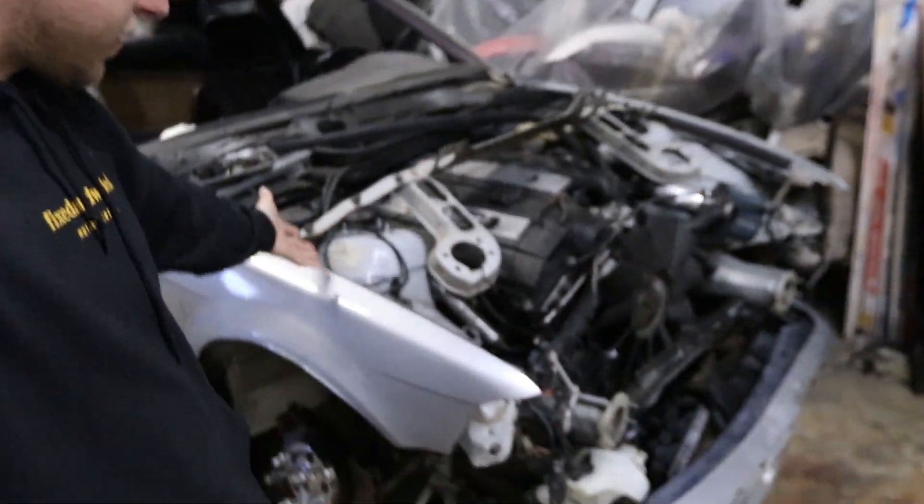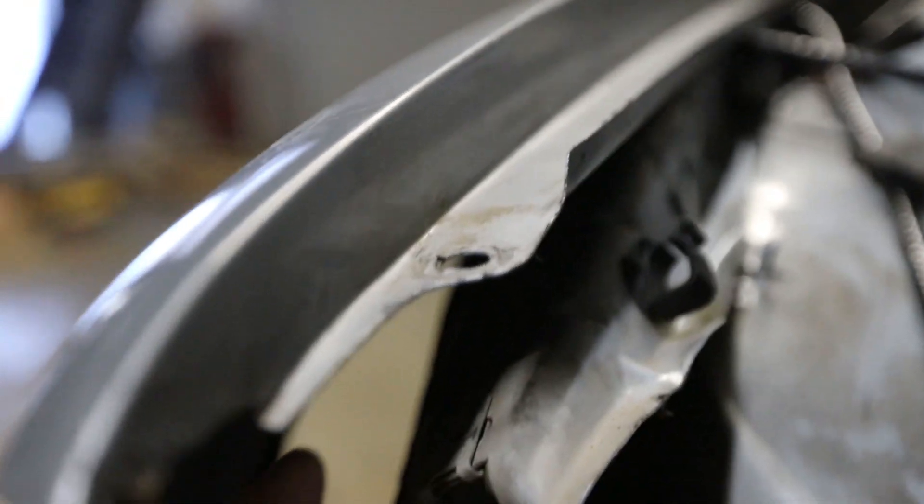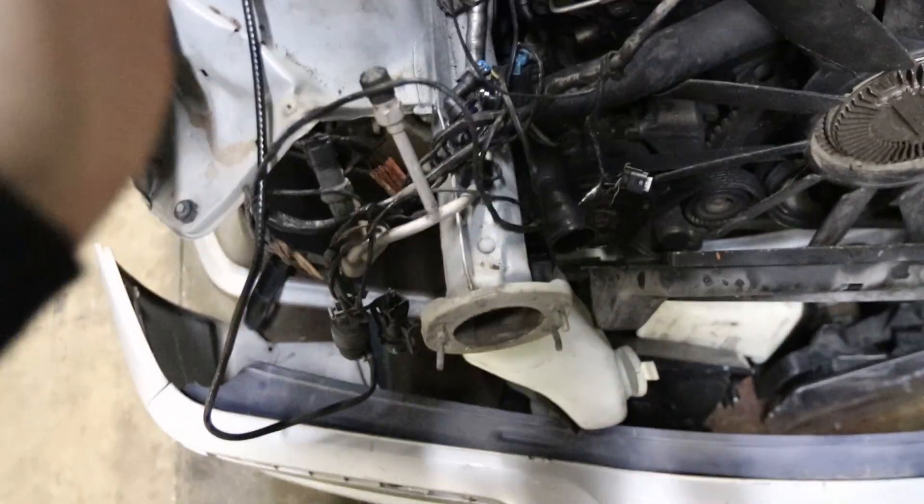So you watched Alex and I take apart the front end a little bit on his car and get things sorted out. This is where we're at - this fender is supposed to bolt up right here on the apron, but this whole apron is crunched in and the pillar, the frame - part of the unibody frame - is kinked in there. So what we're gonna do right now, I'm gonna throw a wheel on the car, get it on the trailer and take it to Johnny's dad's shop which has a frame machine. We'll be able to mount the car, straighten everything out, measure everything squared off to make sure all the new parts will bolt on nice and straight.